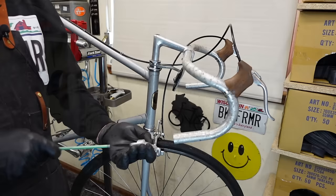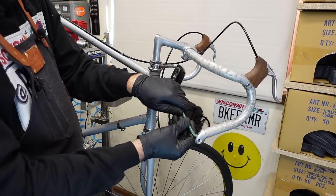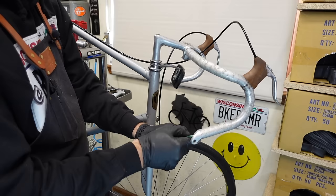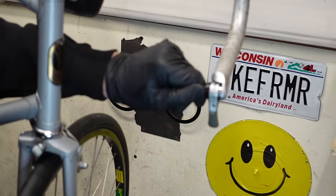Okay, these Shimano bar end shifters, well, I think all the bar end shifters are reverse thread. So put it in there and lefty tighty. And the hardware is pretty soft, so don't get that wrong. You will destroy them. Ask me how I know. You kind of got to know what's up with these things once you get them all put together properly. It's kind of neat because if you flip this guy up, you can put it there, and now you got a friction shifter.